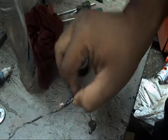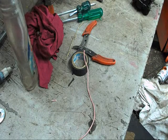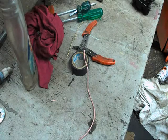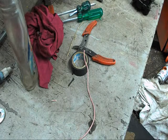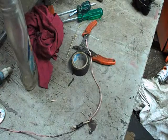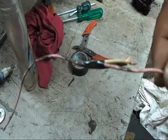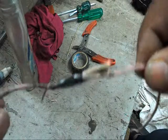Remember, the fuses given by the company are for security purposes. If the fuse is getting blown all the time, that means there is a short circuit somewhere in the circuitry — there is a problem that needs to be addressed. The root cause may not only be the fuse itself, but something else that is short-circuiting the main circuitry. By joining both wires directly to each other, you may increase the issue while riding.